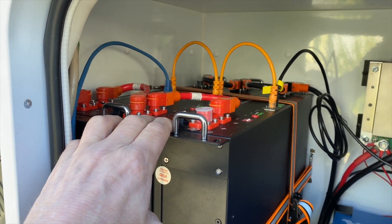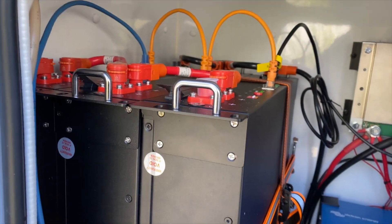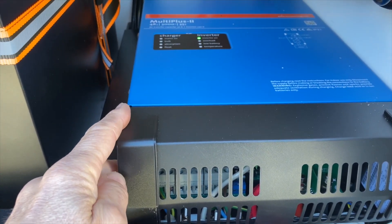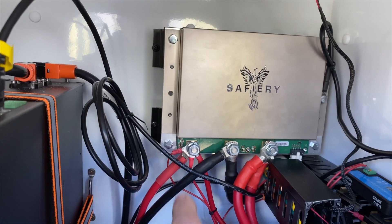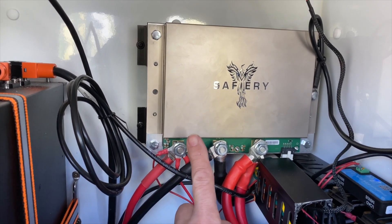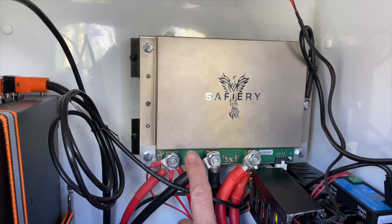It's because of that CAN bus control that we have a longer warranty life. Without CAN bus control it's three years warranty. These are linked together and because they're 48 volt low current, the size of the power cable was only 25 mm squared — quite small. These batteries power up this 3,000 watt Multiplus 2, just an incredible product that you can see down the bottom here. The replenishment power for these batteries comes from both solar and from the buck boost 3 kilowatt device at the back here, which is taking power from the 12 volt alternator. The standard alternator in this vehicle will do 180 amps of output; an upgraded alternator will do 250, but the standard one doing 180 is on this vehicle.